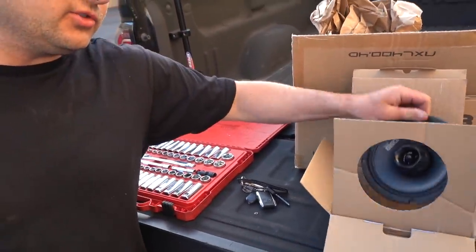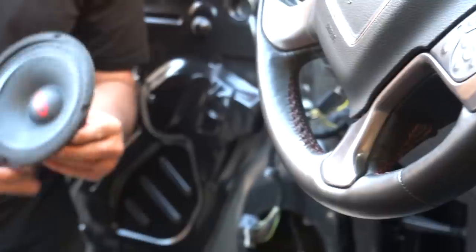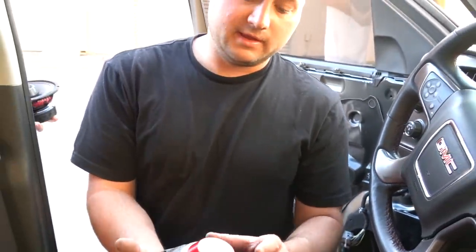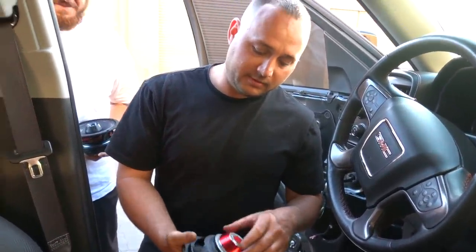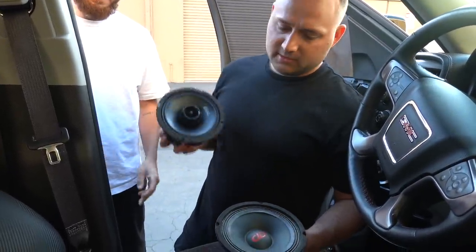So Wes, what's the benefit of these - Chris didn't really explain it very well. It's supposed to be a more efficient speaker, definitely should be louder with the power he has available. It's a pro audio coaxial - a pro audio mid with a one-inch compression driver in the middle, a horn tweeter in the center. Pretty efficient speaker. Here's the DD Audio six-and-a-half mid-range driver - as you can see it's quite a bit smaller. This is a neodymium magnet motor so it can be smaller and have the same power. I think this is going to be a pretty good upgrade.